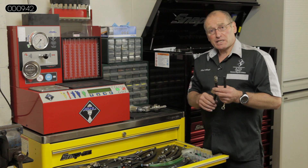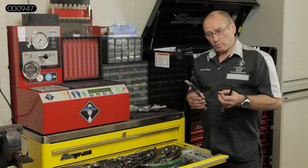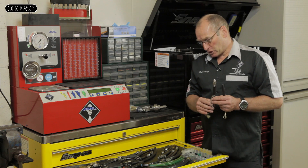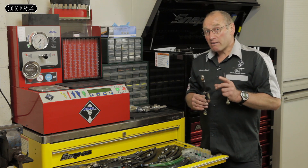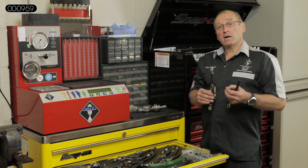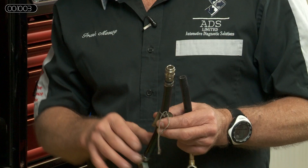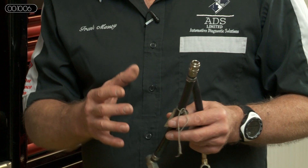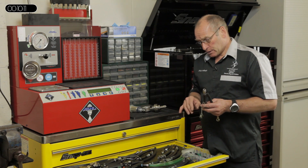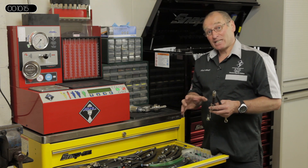The gauge is also designed to test petrol systems. With petrol systems, we have manifold injection at around three to four bar system pressure. We also have direct petrol systems, which are an on-demand pump running from anywhere from one bar up to around five and a half to six bar. So all of these fittings are infinitely flexible between both diesel and petrol, although the most demand these days for different fittings and adapters comes from diesel rather than petrol.